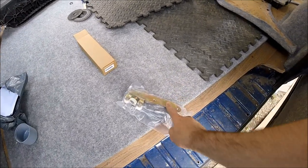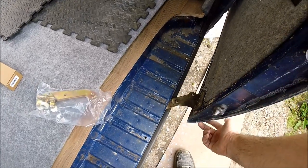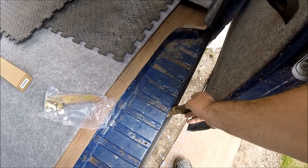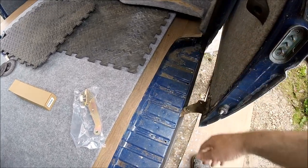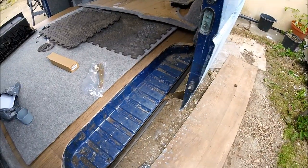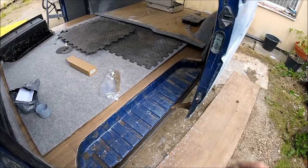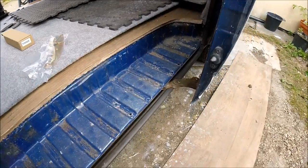It should be a relatively simple and straightforward swap — it's just got two large Phillips head bolts to unscrew. We'll need to support the door because when you take the roller off the door could potentially drop a little bit. We'll get the new roller fitted in place using a straight reverse procedure, and hopefully within the next 10 minutes or less we should have a fully replaced roller for the sliding door.